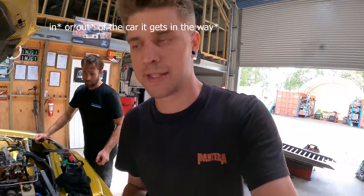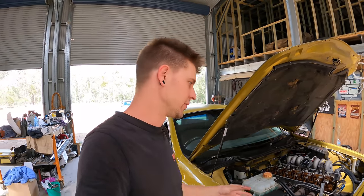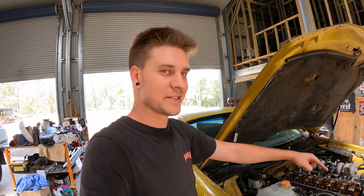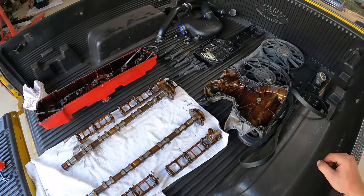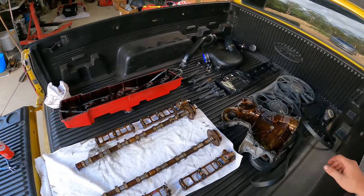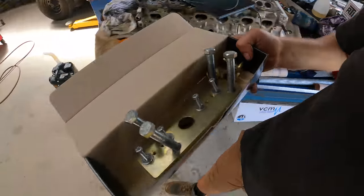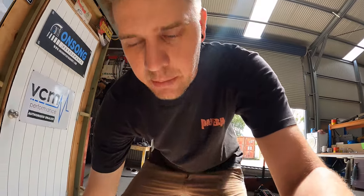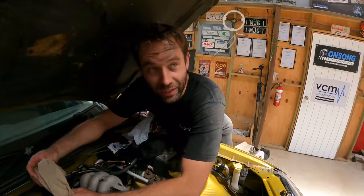When doing this, you only want to remove the plug on the cylinder you're working on. Leave the other plugs in because you need that compression in those other cylinders - otherwise when you pressurize the cylinder, there's no way for the others to hold the motor from turning over and you push the piston back down to bottom dead center. We also plug up all of the oil drains in the head with rags on the intake side between each cylinder. Last thing you want is to drop a lock and have it find its way down into the sump.